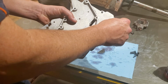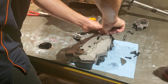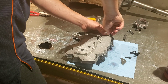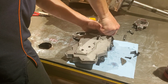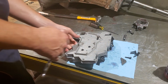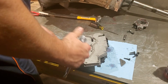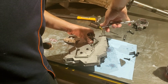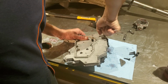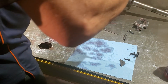This one, your ID tag should be up here in the corner. All right. Now that those are in, we can go ahead and tighten this down. I mean, this is like, ouch, 8 foot-pounds. Anything more than a good snug on a nut driver, and you're probably going too hard. You can definitely lock down the valves inside.